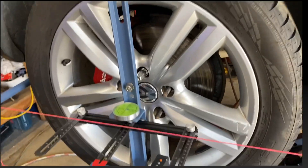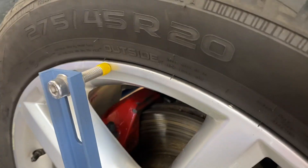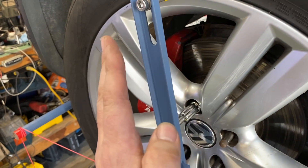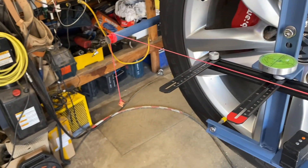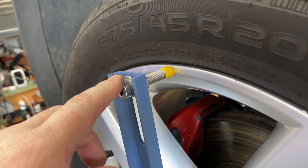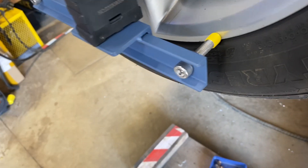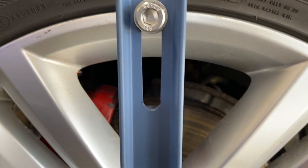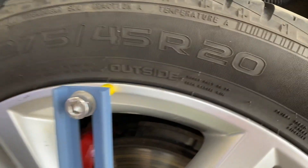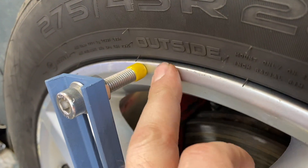That's one of the frames. I've made four of these frames that get clamped onto the wheel. It's adjusted so each frame is absolutely straight. I put it on a known level surface and use one of these measuring devices. I sit it on top of the frame and adjust it so it's absolutely level using these little cap screws. It's threaded and adjustable so it fits various wheels.